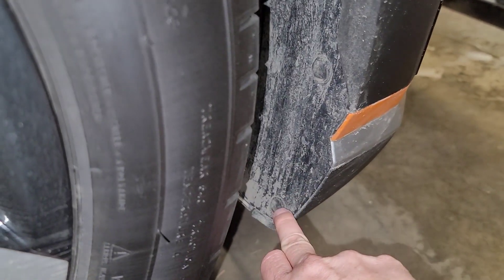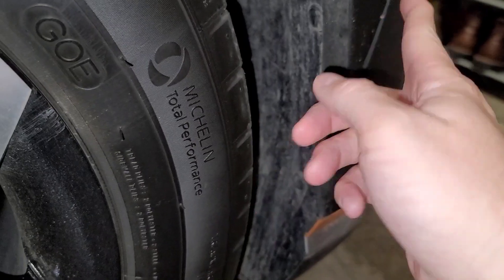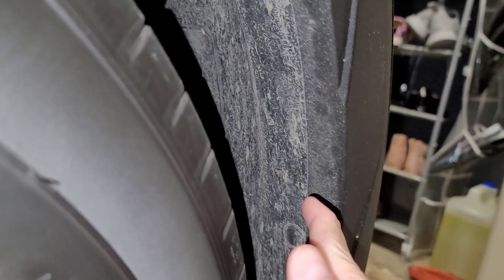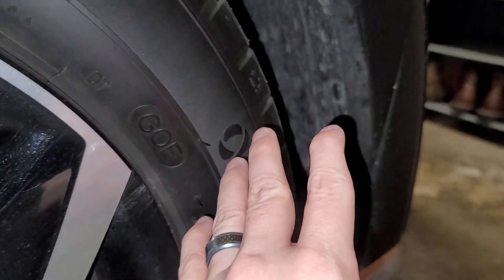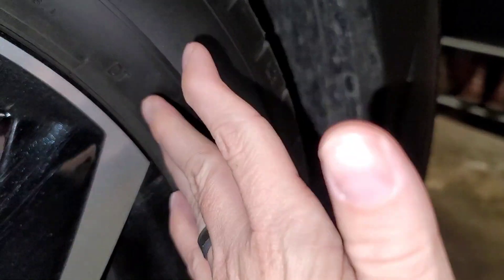For the front, you can see right here, there are these little clips. Turn the wheel — if you're doing the passenger side, turn the wheel to the left. There's this one down here; there are two underneath. Do this one and this one. Do not need to take that screw out. Then literally just pull the fender back, and the bulb is right in here. You can reach in and it's just a typical bulb socket — all you do is twist, pull out, replace the bulb, put it back in, twist, and you're done.